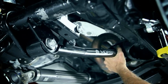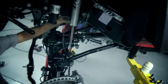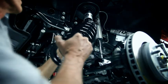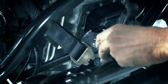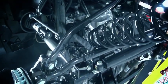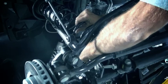Don't tighten any of the suspension bolts until the Jeep is back on the ground and at ride height. Before installing the front coil springs, make sure that the brake line is routed to the inside of the shock. On the driver's side the spring install is straightforward. On the passenger side, slide the spring in from the front between the drag link and the tie rod — it makes it pretty easy to install.